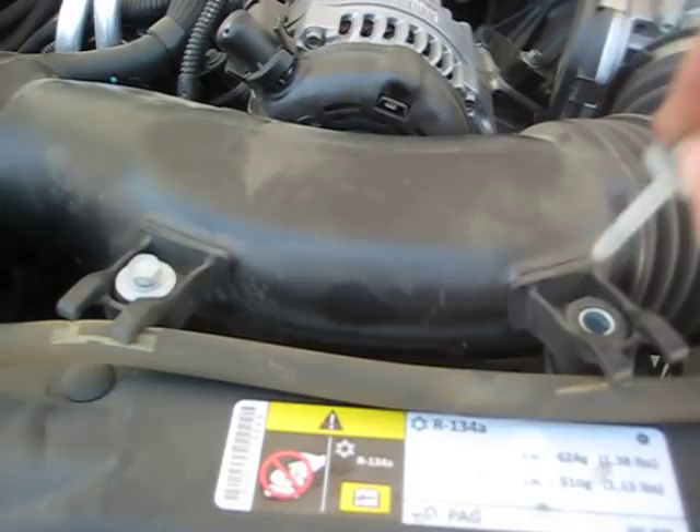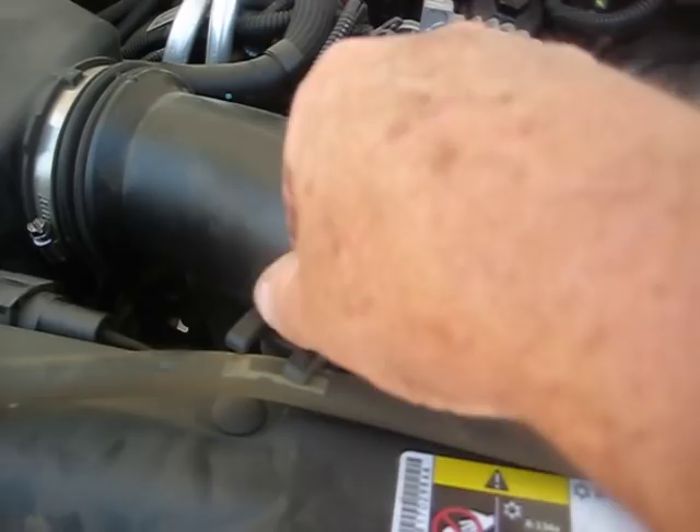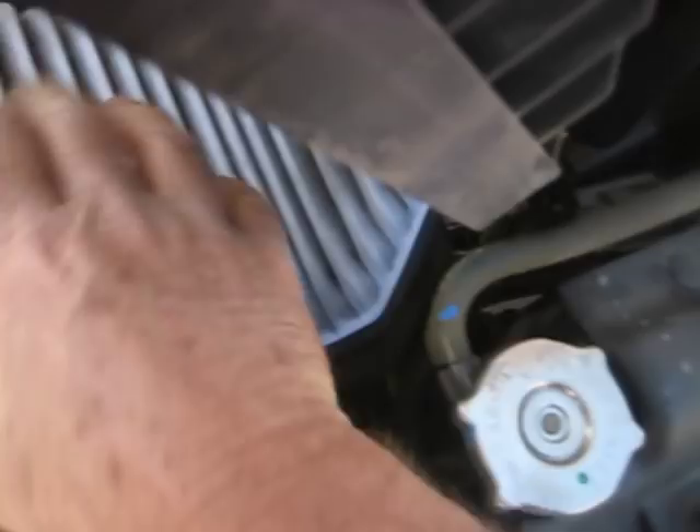Now how about the air filter? The air filter is right over here in this box. First thing you want to do is take out these bolts — I already loosened them — 10 millimeter head. Then there are four clips: clip one, clip two, clip three, and clip four. Lift that sucker up — there's your filter right there. She's a pretty dirty little bug.